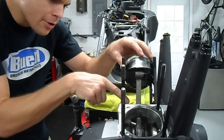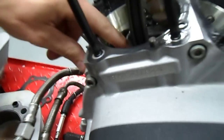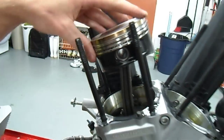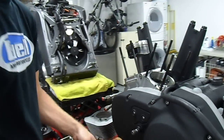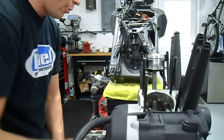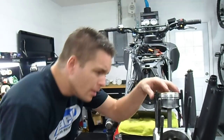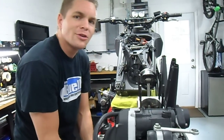You can see here from the side the front rod is significantly bent, and the rear rod has splintered around the front rod. So on these things, if one rod goes there's no real safety in the other rod. Both oil jets are also broken on the front cylinder there. But all in all, this is actually better than I thought — surprisingly.